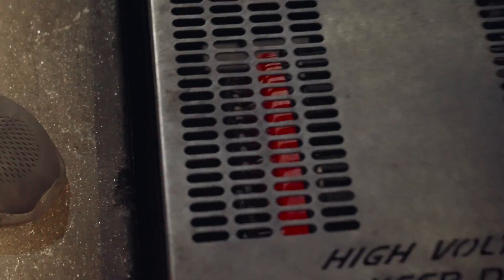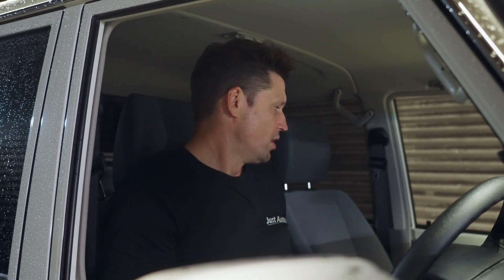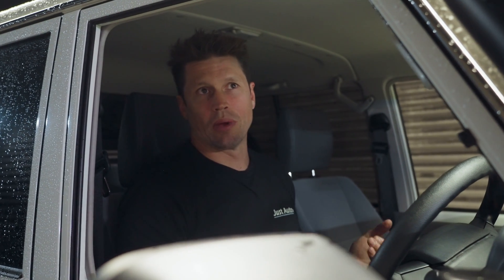Having a look at the data, we can definitely start to see our temperature increases and so forth. If you get out of the car right now you can see the retarder is glowing red hot — we're adding full load to that car and that's how it glows like that. So that's what we're showing you — three minutes 15 seconds. We've finished the run with the heat exchanger on board. We've got our log here and we're keen to go back and analyze it against yesterday with the standard cooler in place. Already I can see some of the temperatures starting to stabilize a lot earlier, which is a good thing. We'll do a bit of a summary and show you the results.